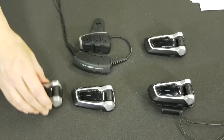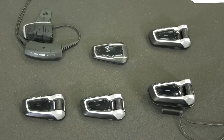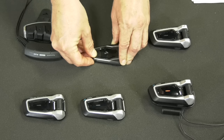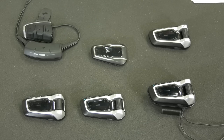DMC is not an exclusive club — you can also bridge Bluetooth units into the DMC party. First step: pair the Bluetooth unit to your Packtalk Bold. Switch your Packtalk to Bluetooth mode by pressing the intercom and phone buttons together — make sure music streaming is turned off before switching modes. This unit should now flash blue, meaning it is in Bluetooth mode. Activate Bluetooth pairing by pressing the intercom button for five seconds or until you hear the third beep. Activate the other unit's Bluetooth pairing and let them pair. Packtalk has universal pairing, meaning you can pair it with any Bluetooth headset of any brand. Toggle Packtalk back to DMC mode by pressing the intercom and phone buttons together — make sure the indicator light switches from blue to green. Back in the DMC group intercom, click the intercom button and your preset Bluetooth bridge is now part of the party.